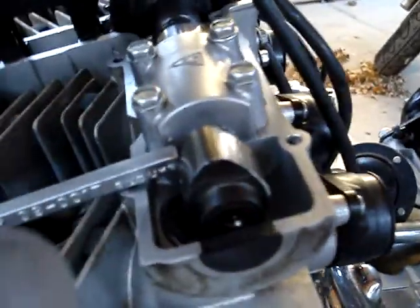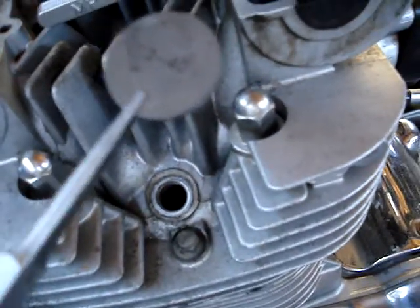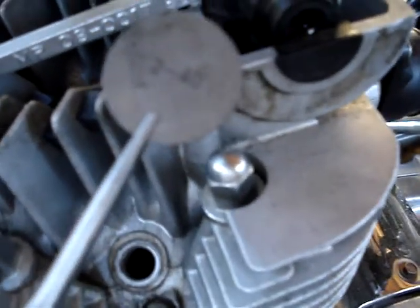You need to get the proper size shims, and they're at Universal's charging me $10 a piece. So I pulled this one out — this was a 2.4mm that I was testing out. I think the original shim in this first cylinder intake valve was a 2.85mm, so there's quite a big difference when you're dealing with thousandths of an inch. I tried this one and the clearance is a bit too big — it's 0.127mm with this shim in. So I'm going to try the 2.45mm shim.